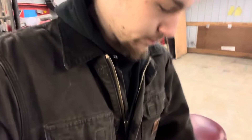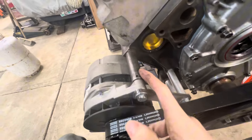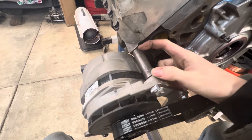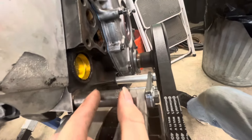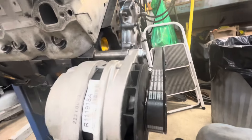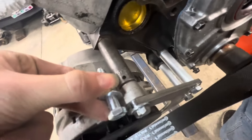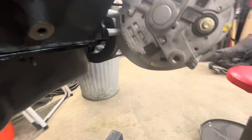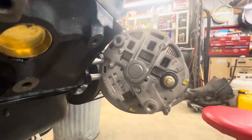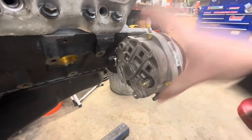I lied, I'm back. So I put the alternator on backwards. This was my fix for that short piece wobbling around — I just put a 9/16 socket on it, and it was surprisingly the perfect length. But if you look down here, the thickness on the alternator is supposed to be up here — that's why that short piece is up here — and this thin piece is supposed to be down there. That's why I was complaining that the hardware was too short for the thick piece. The only reason I put it on backwards was because I wanted easier access to the ground and the plug for the harness. I didn't even know this alternator had to go on a specific orientation. So let's change it real quick.